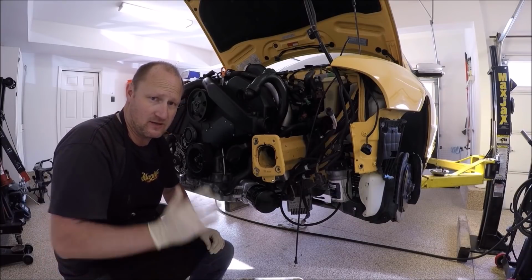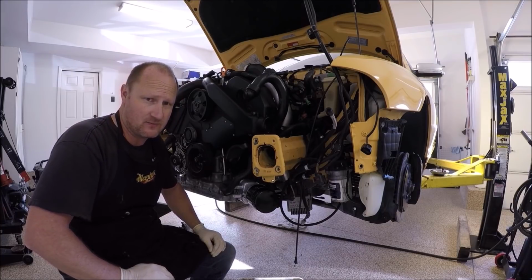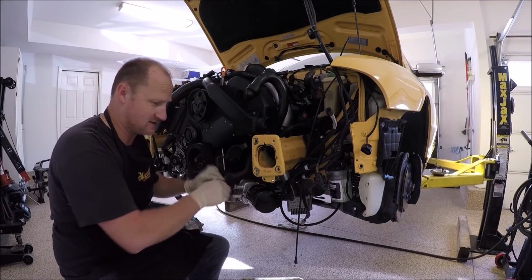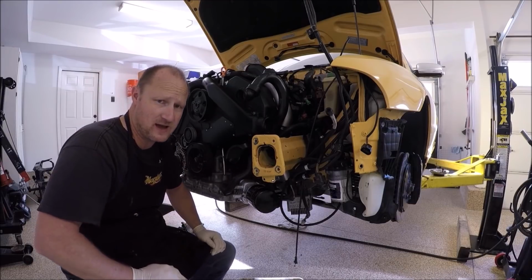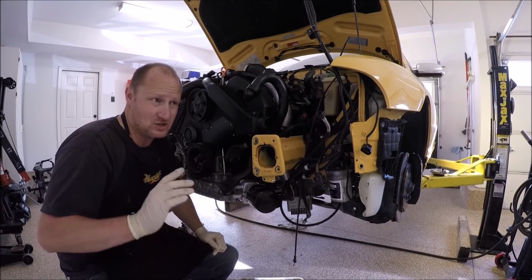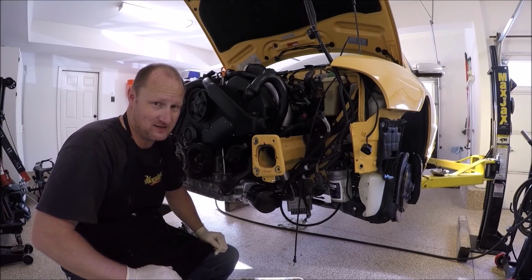Now that the clutch feels great and you have it done, let's go ahead and install the AC compressor. Now I do have some extra stuff on here. I have an oil cooler, so if you guys look, you might see some different things on here. To put the compressor back in, along with the lines, you have to remove the oil in the car and the oil filter. I showed you this in the engine removal video, and it's just the same process in reverse.